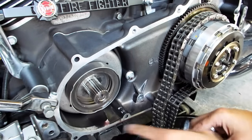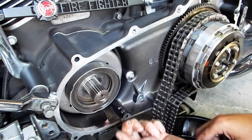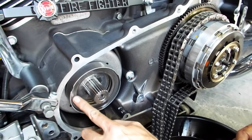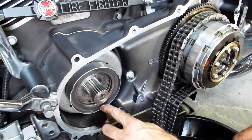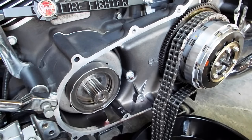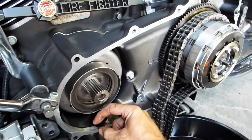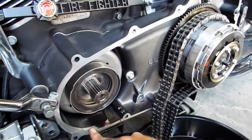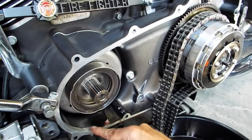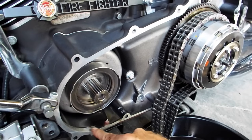The spring pack itself — let me wipe this right here. There's a little grit, and I did notice a little bit on the plug when I took it out. On the magnet on the plug there was a fine particle that had accumulated. There's still some lube inside here, which is a good sign. Time to slide this piece out and put the new one in. I ground down with a Dremel tool and a grinding bit — I ground away a little bit of this aluminum, and was surprised at how little actually had to be taken away.